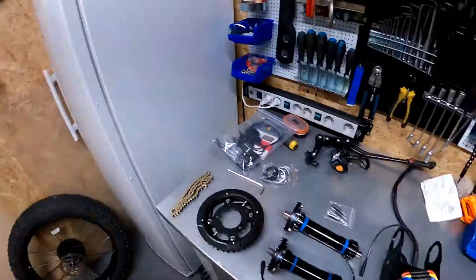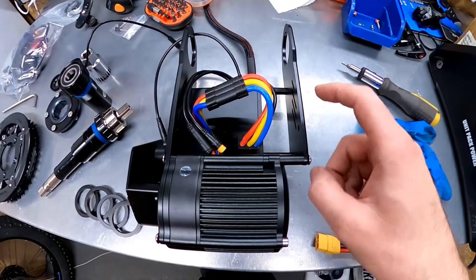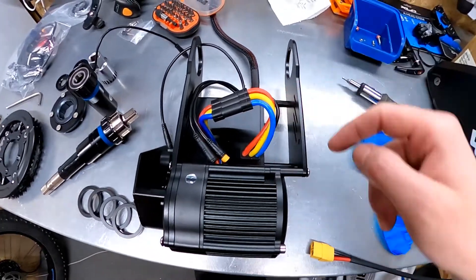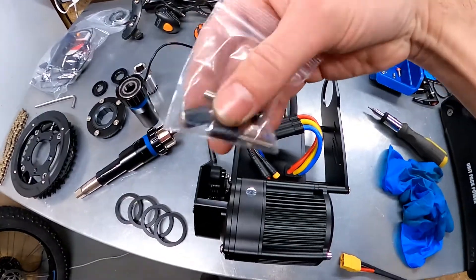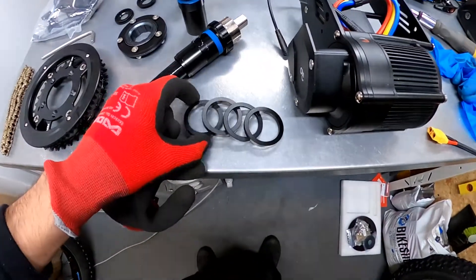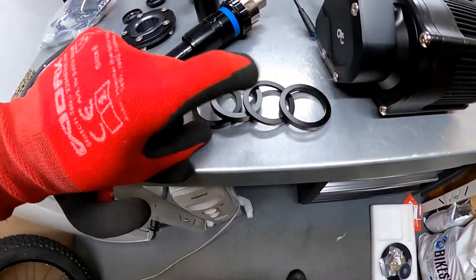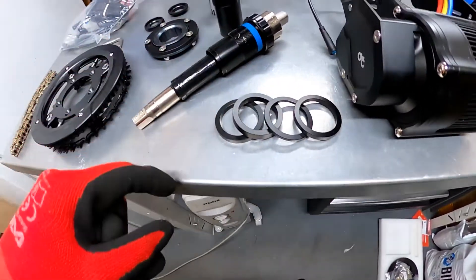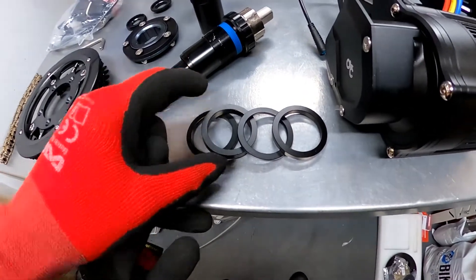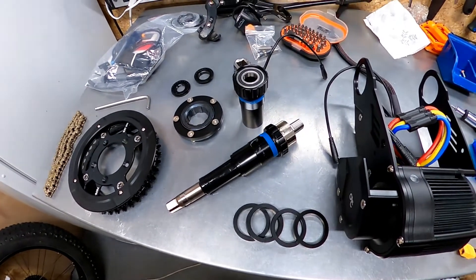Now I will be going to the installation of the motor. This is a modified motor with a 220mm crank version. New spacers are installed — I am keeping the old ones as spares. Here you can see the spacers I will be using in this build. I need around 20mm total thickness. Now I just need to assess which direction of offset I want to achieve to get the best chain line.